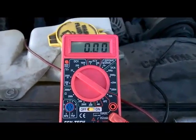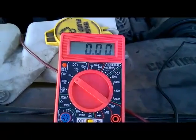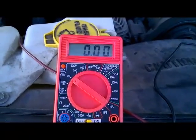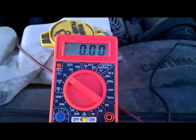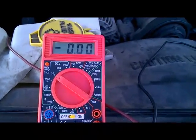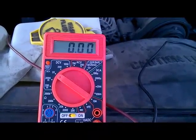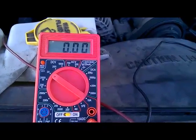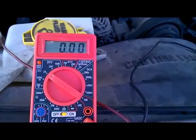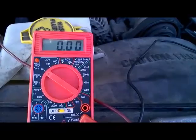But my only concern is our EGR signal. When I was wiggling the housing on the EGR, our voltage was fluctuating. So that could be a potential problem here. But before condemning a potential sensor side of the EGR, I will also remove the EGR and perform a visual inspection just to look at the EGR pintle to see if it's maybe stuck partially open due to carbon buildup.